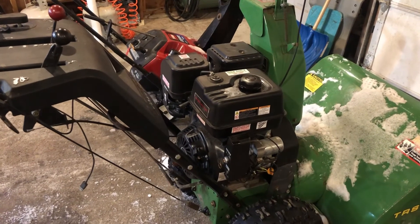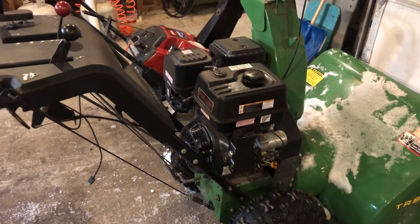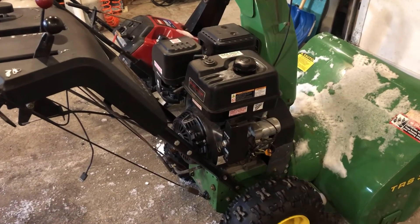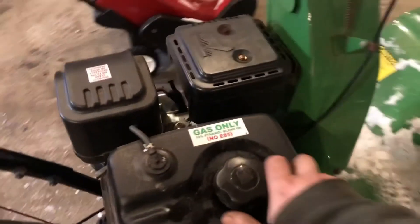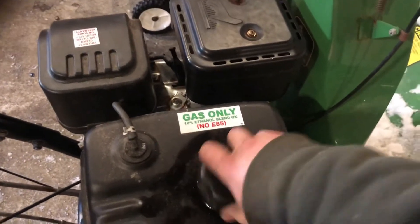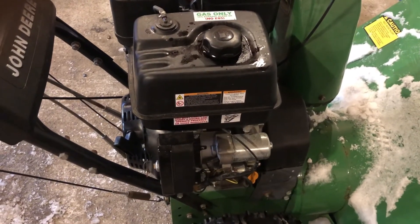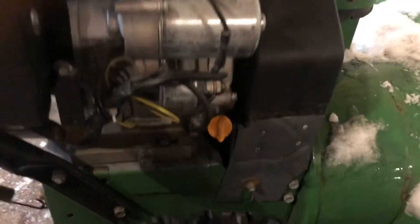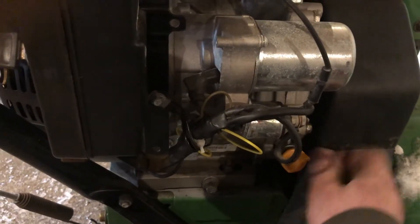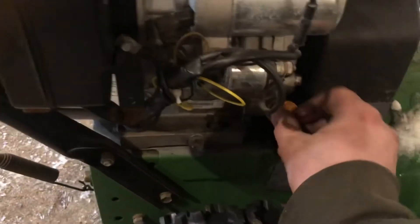Okay, now we took a look at an engine sitting on the desk separately. Now let's take a look at these two engines on both snowblowers. The first thing we'll want to do is check our gas — checking that the tank is full, and also that it's fresh gas, less than six months old ideally. If you have any doubt, try replacing the gas if it's giving you a hard time getting started. Then, with this being a four-stroke, it receives its lubrication from oil on the bottom, so it's a good idea to check and make sure the oil is where it's supposed to be.